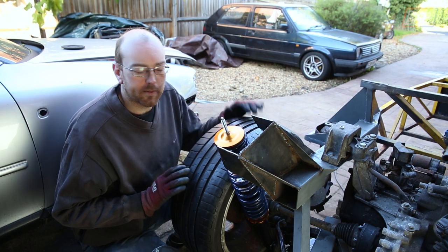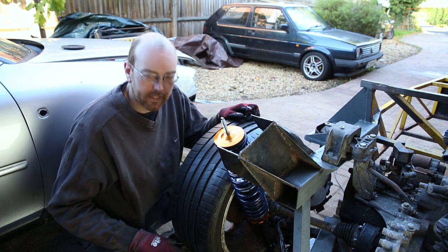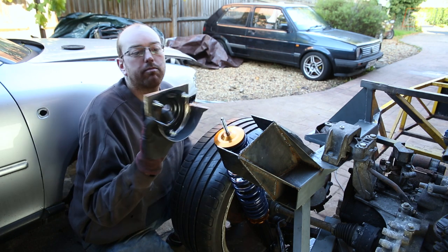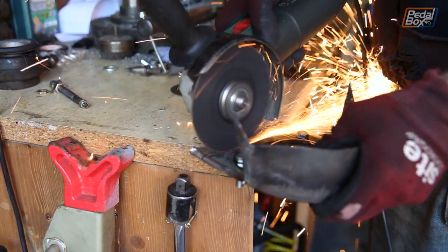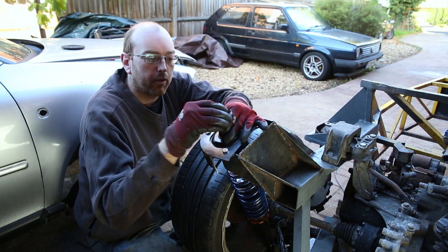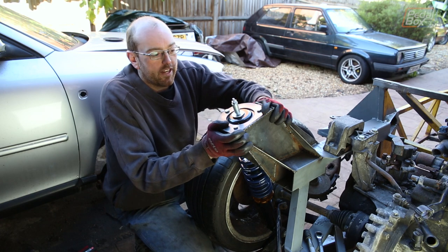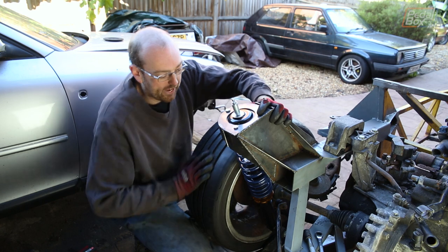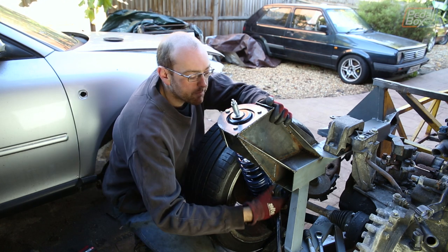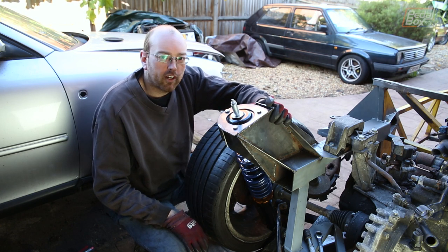It's been a sad and cold morning cutting off the top mounts and undoing a lot of work — I don't think we've ever gone so far back into a project within the same episode. We've cut off about 20mm from the back here, and now we can put it back on top, relocate it, and see how it is with the coil slanted a little further inboard than before. We can move it in onto its new home, get rid of the squeak, and we just need to move the bracket forwards slightly to stop it touching the radius arm down there.